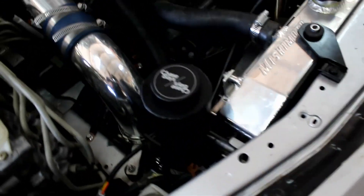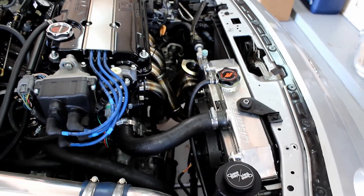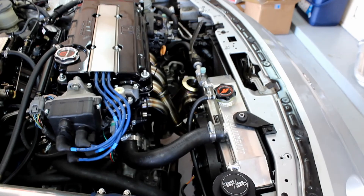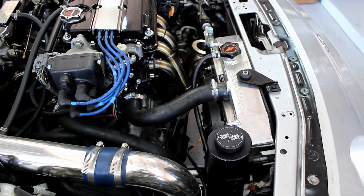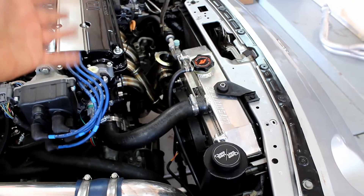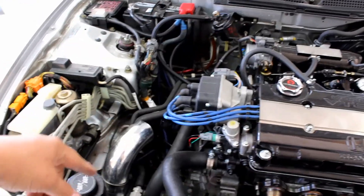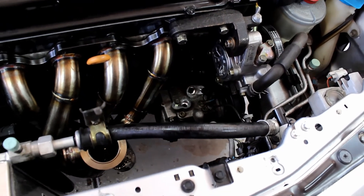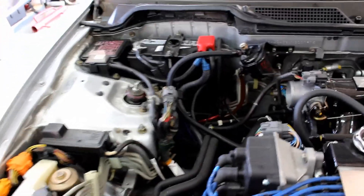Custom builds — pain in the ass. We're gonna have to move the radiator somehow, somewhere. We haven't figured that out quite yet. What we did figure out is we're gonna say screw it to the AC — at least we're not in Phoenix so it doesn't get that hot, but it's irritating. So we're just gonna take the AC out. At least we're gonna have power steering. We're taking off the intake; I already took off the AC lines. We're gonna unbolt the AC lines from the firewall, which looks like it's under the battery, so we have to take the battery off to get the AC lines off.